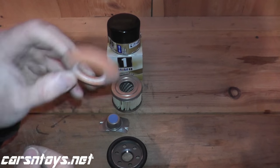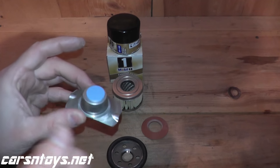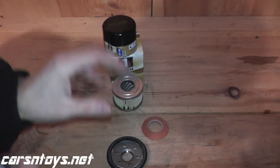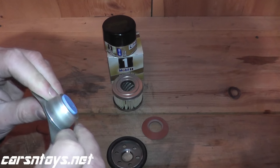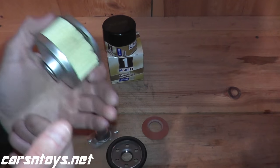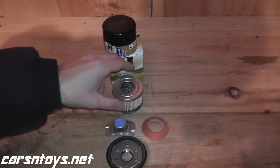The silicone anti-drain back valve is one of the key things you're paying for with Mobil 1. Next is the bypass spring. This stamped piece of steel keeps everything compact in the can — the filter, the bypass spring, and anti-drain back valve are all kept compressed. The coil spring opens up if the filter ever gets clogged or filter performance degrades, ensuring motor oil keeps flowing. It may also open under hard acceleration — it's essentially a safety device.